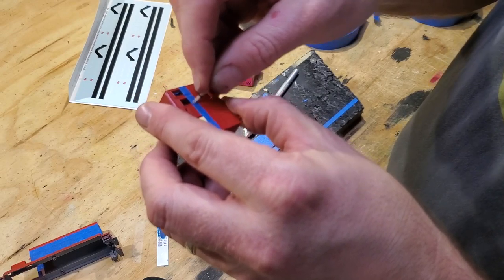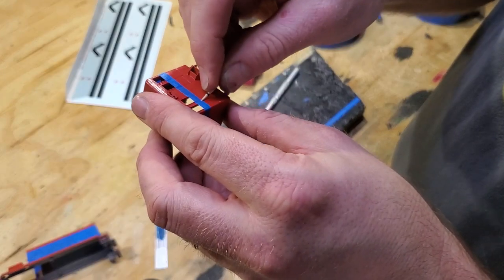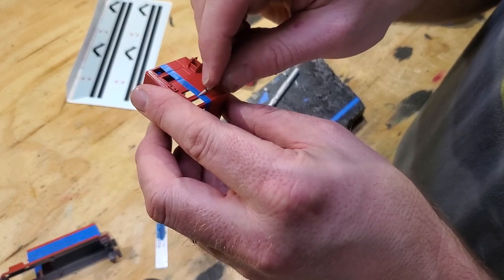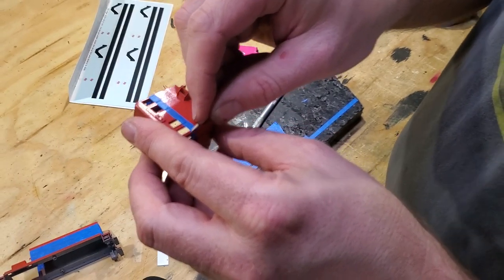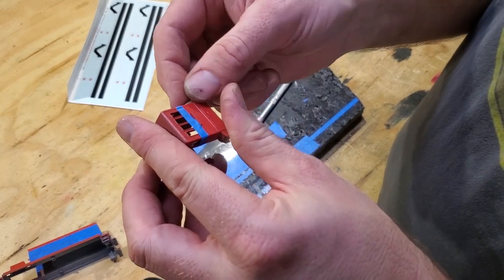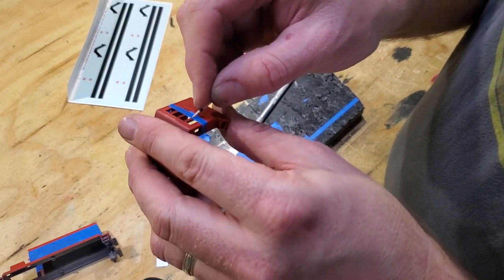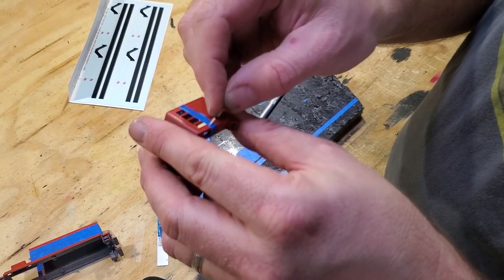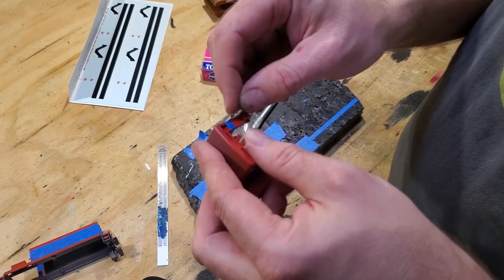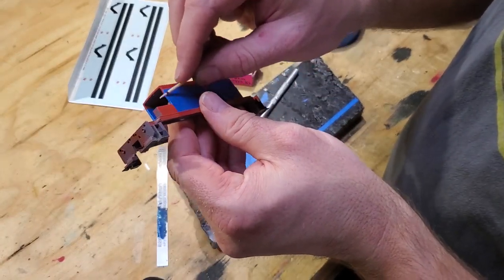That's where we want to be on that, so there's no messing around. And actually, it's important to do on the raised surfaces too. We talk about the surfaces in between, but we also need to pay attention to doing that on the raised surfaces so we don't get paint running under, like I said, those window sashes and whatever. So, and we'll go on to doing the same thing with the long hood. And I'll be back with you when we get finished with the masking here.